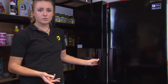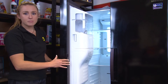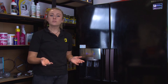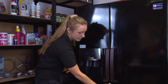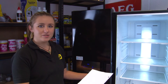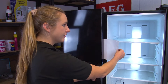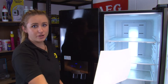If nothing is obstructing the doors then you'll need to check the door seal, checking for any cracks or damages that might prevent it from shutting properly, which will prevent ice from being produced. You can also go around the outside of the door with your hand checking for any cold air that might be escaping. If you can feel any cold air on your hands then your door seal will need replacing. You can also check the door seal by placing a sheet of paper between the door and the fridge — if you can pull the sheet of paper out without any resistance then you'll be in need of a new door seal.